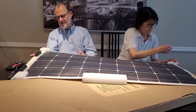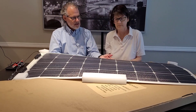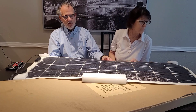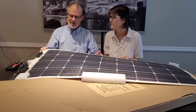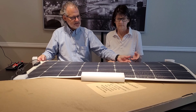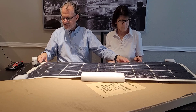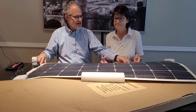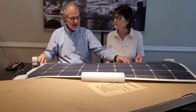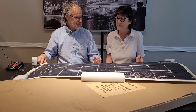I'm hoping to find a double-sided adhesive or a contact paper, or alternatively a glue that we can use to hold these down. They also have grommets through which we can bolt them onto the roof of the trailer. We have five of these solar panels. They're fairly flexible and completely flat when installed — a good fit for our trailer and very lightweight. The solar panels will only add about 20 to 22 pounds to the trailer, which is much less than the inverter that probably weighs 30 pounds or so.